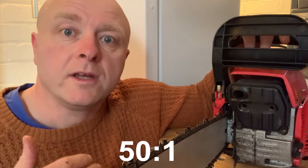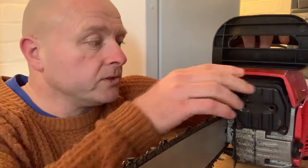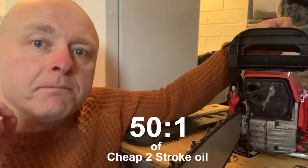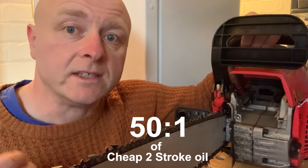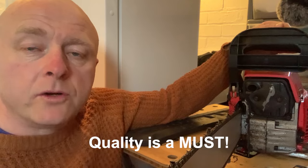I remember a few years ago when I was working for a Stihl dealership, a gentleman came in and purchased a professional quality Stihl chainsaw and took the 50 to 1 fuel-to-oil mix advice and went away in the morning. In the afternoon, he was back — the chainsaw had been running but now it won't even start. We had a look all around it, and in the end we took off the exhaust and had a look inside at the piston. The engine was ruined. He did profess that he had used oil but admitted it was an inferior type, and showed us the bottle — a name I'd never heard of. And it wasn't covered by warranty because of what he'd done. So that just goes to show that a good quality oil is a must.